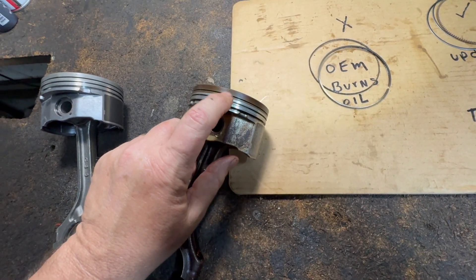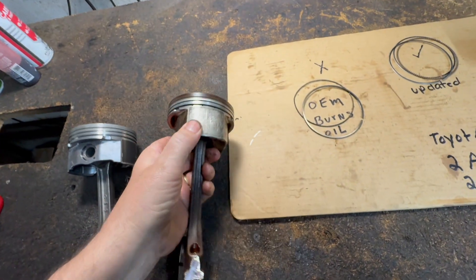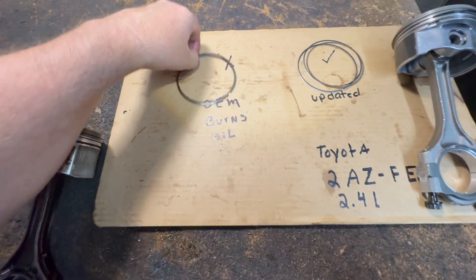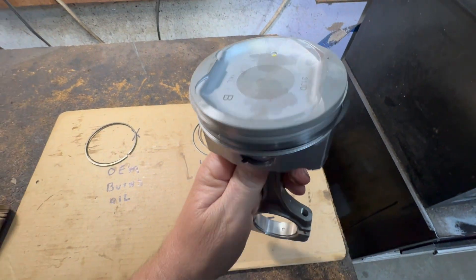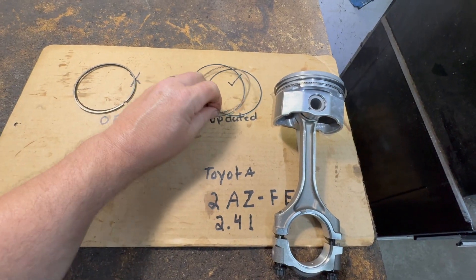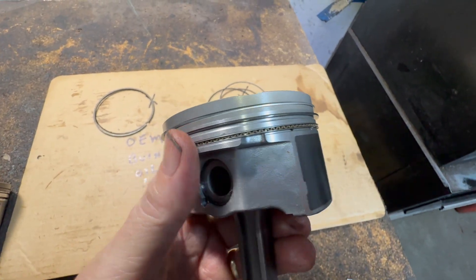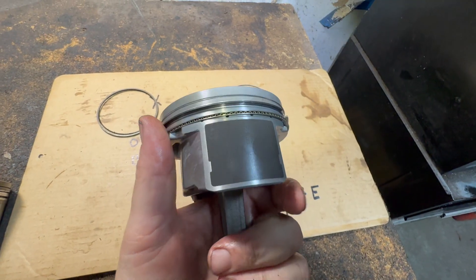When the ring scrapes the oil, the oil has nowhere to go — it can't go back into the piston. So it bypasses the oil control ring, goes up past the second ring and even the first ring, and burns. That's your oil burning. So what they did — they upgraded it. This is the new piston design. This style piston and rings has been around for a long time — why mess with a good thing? But they did. Now it looks like a normal regular design found on a lot of American cars.